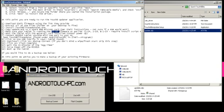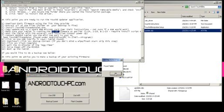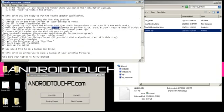Alright, step 6, boot the tablet with the external SD card. Connect the mid 816 tablet via mini USB port to your PC, which we've done. Open the Touch 8 Elite Updater, which you can see right here. Click on Use USB. Verify it says tablet found. We have the current drivers, so we have found tablet, no problem. Like I said, if it says tablet not found, you're going to need to follow the steps up here: if you have XP, install PDA-Net if you have Windows 7, or there's some other ways to get the drivers as well.